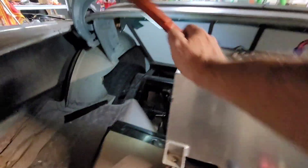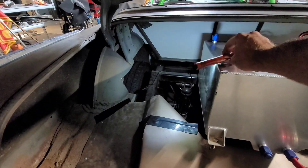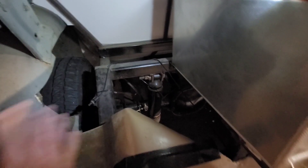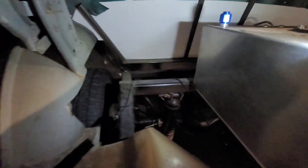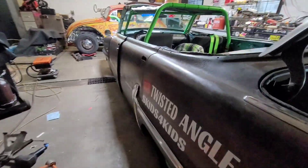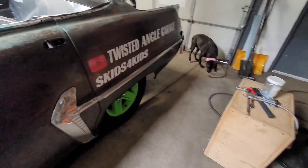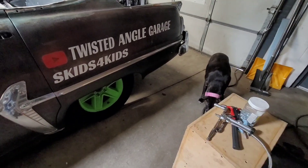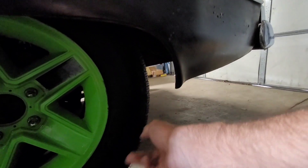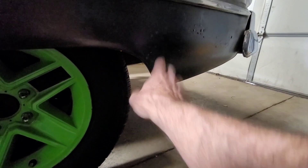What I'm going to do is take some thicker steel and weld it in on the bottom side into the frame and body — it's all one solid piece now with no bushings — and box it all in so it's safe for blowing tires. I'm also going to get a piece of angle iron, about one and a half to two inches, six inches long, and get it bolted up behind the wheel and sharpen it so when tread starts flopping it will help cut chunks of that tread off.